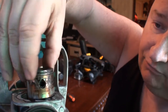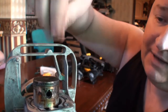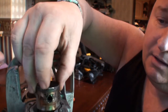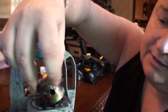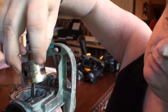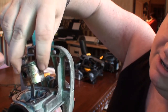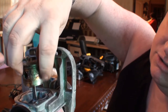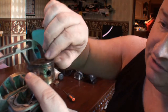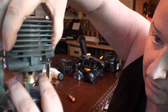The actual piston ring is seized in the groove. What's probably happened is, as the piston's been going up and down, it started to perform quite badly — due to carbon that's built up, got past the rings, and got stuck in them. Then you've got blow-past, which shows on the side of the piston below the ring, meaning you're not getting good compression anymore. You can see the score marks where bits of carbon have gone below and worn grooves in the bore. Normally you'd have to pinch the ring to fit it — but look how easily it slides on now.